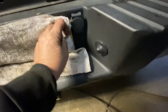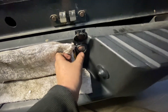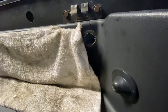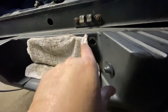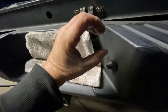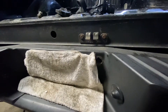Over here you got your little key thing — put your master key in here and take that off. Once you got that off, you're gonna look in there and it's gonna look like a funnel. It looks like a big funnel in there and it's gonna guide the long bar that releases the spare tire. It's like a big funnel and a little plastic thing, and it guides the rod in so it can connect to the crank mechanism that brings the tire down.